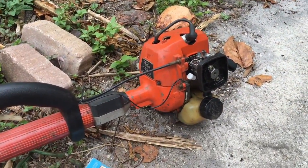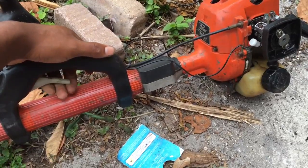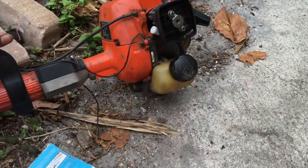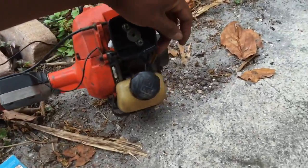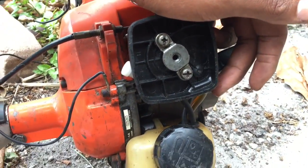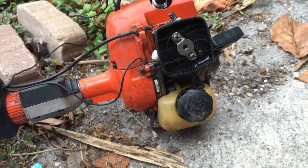Okay, so I got it started. It doesn't turn off when you disconnect the coil wire, and it doesn't have any compression when you pull full throttle. So I think just a head gasket will fix that, along with getting a new muffler. The engine starts — to turn it off, what you have to do is in the intake, you take the filter off, and that closes the intake suction hole. Then you apply that, it can't pull any air, so it just cuts off.